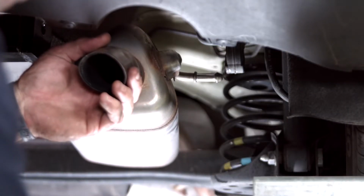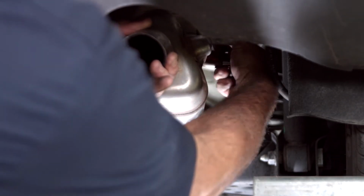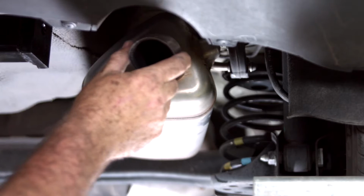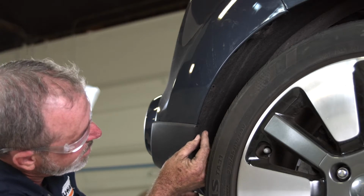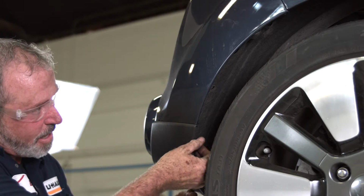Okay, so we're just going to raise this exhaust rod back up to the exhaust hanger and just kind of work it back into place, just like that. You can see with the bouncing around, it doesn't touch the hitch or rattle against the hitch. We're just working in reverse here, getting the fender lining back into place here with the 3 screws and the 3 plastic fasteners.